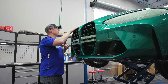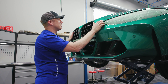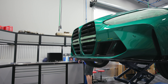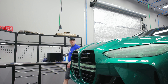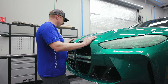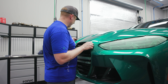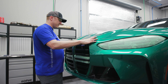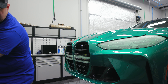There's some bug residue — hopefully we can get most of that off. Shawn's not going to do paint protection film on this car because he's not going to be doing a lot of highway driving and Orlando is pretty forgiving. We'll start here and work our way around and down. I think I'll start with the three-inch. Since I'm just doing a one-step finishing with Sonax Perfect Finish, I'm just going to leave the hood closed and go right over it with my three-inch polisher.